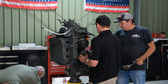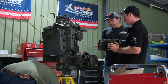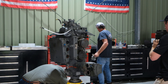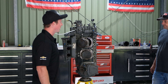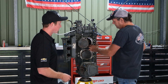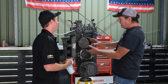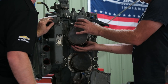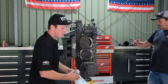Keep your hand there — you've got to keep the pushrods in the tubes. Keep the tube this way and just keep wiggling to get it past the piston — that's good. Done. Two down, two cylinders off now. We haven't pulled the pistons off yet. The pin buttons are actually seizing the piston because the motor's fairly corroded, so we're going to have to knock them out — we'll need to tap them out. Normally you don't have to — if you pull an engine apart that's just worn out, they come out with your thumb. As soon as the cylinder comes off, you've got to grab the button so it doesn't fall out.